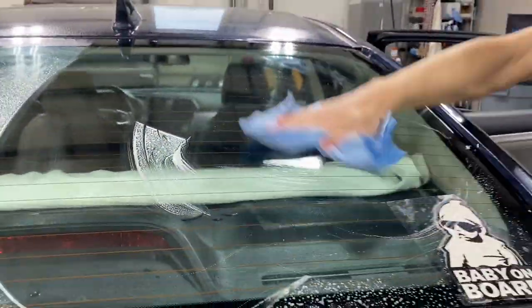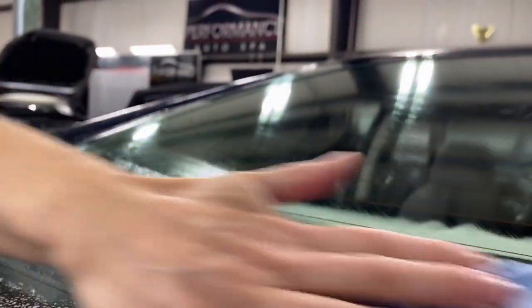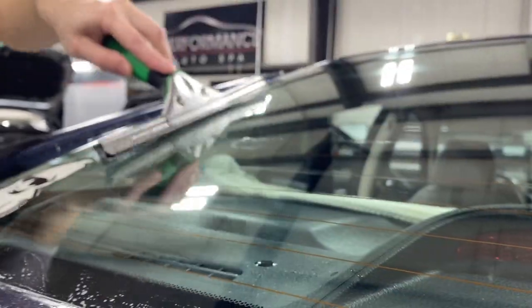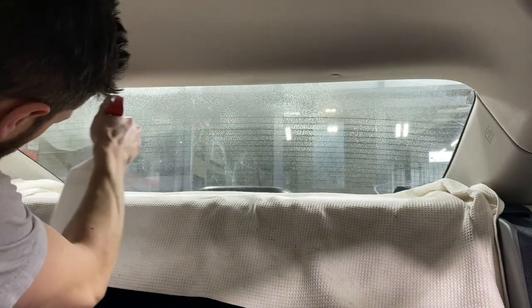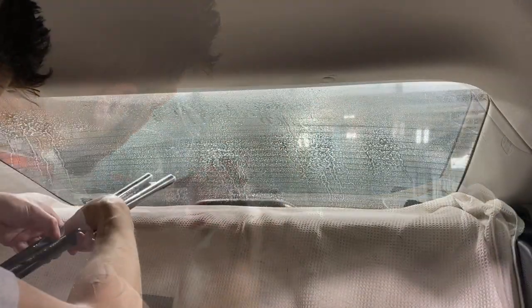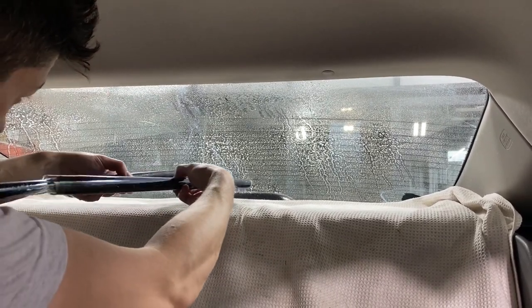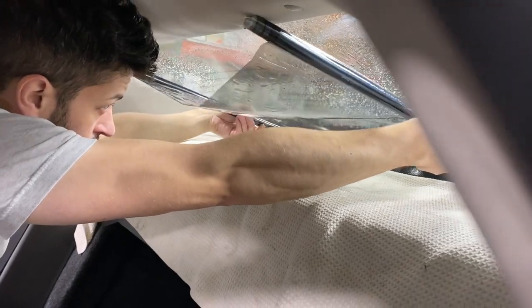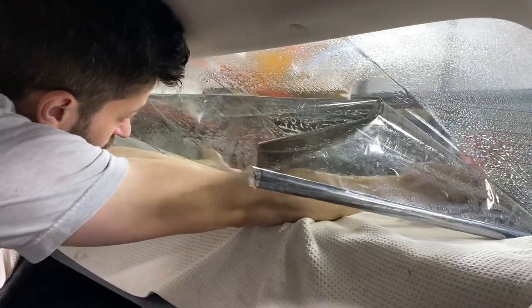One final clean with a blue towel. This is the Unger channel squeegee A1412 with the A1400E Unger handle — bigger pieces help with flat glass and large back windows. Coming in just making sure this is totally saturated. That's why the dash towel is there. He gently separates the film from the backing material, sneaking it behind the third brake light — with the double scroll technique, no dirt gets introduced onto that window.